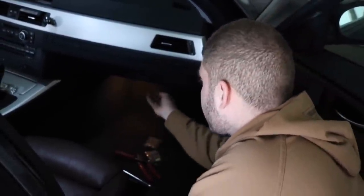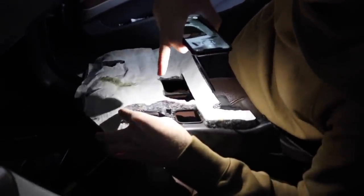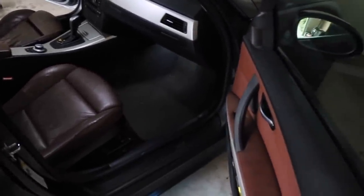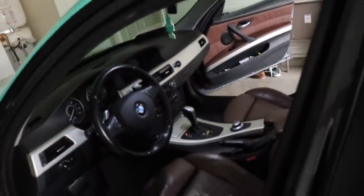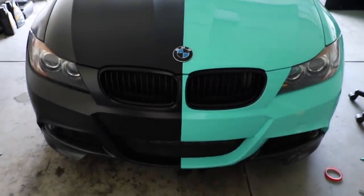We just got all the interior lights on the top. We still got these bottom ones — there are four bolts here. Remove them, take the whole undertray out, and then replace the bulb from the top held down by four T20s. Once you get that out, this whole tray comes down and you just have to unplug and replace the bulb. The footwell should light up in white. All right guys, the white interior lights are in — and honestly it makes the aluminum and the brown leather stand out, which I really, really like. I didn't think I'd like it but look at that — it looks super sick. Even the trunk. You just have to take it out, take your time.